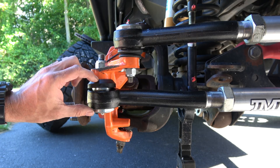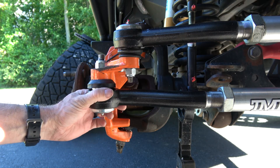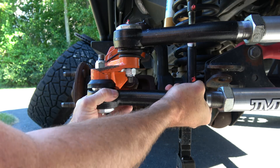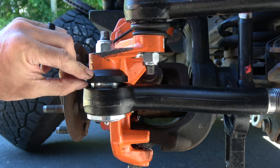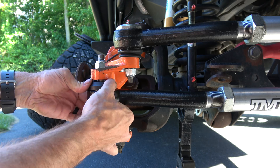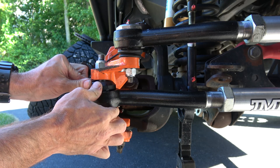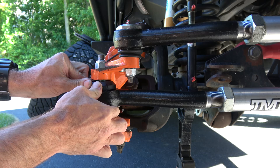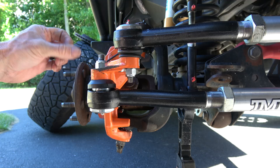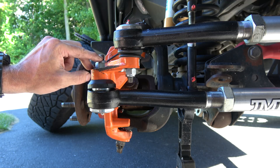Here's the problem statement. I have new Reed knuckles, new two-and-a-half-ton tie rods, but I also have this special lockout washer slash seal from TMR Customs. Normally the seal would fit down fairly tight and hold everything in place. However, I've got a little extra gap there because these Reed knuckles are drilled and reamed at a little bit smaller than OEM dimension.